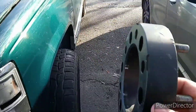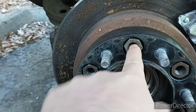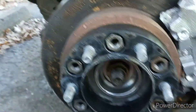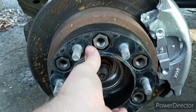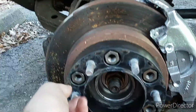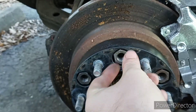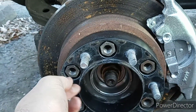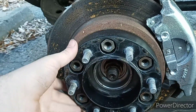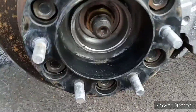These are 1.5 inch. All right you guys, this is what I was talking about — I can't get my lug nuts tightened up all the way. These are just tightened up by my finger and yeah, it's pretty well gapped out. So either I'm gonna have to figure out how to get these lug nuts tightened up — I don't think they make anything small enough to fit in there — or I'm gonna have to trade these for some Chevy wheel spacers. But I got this thing on here and it's not moving.